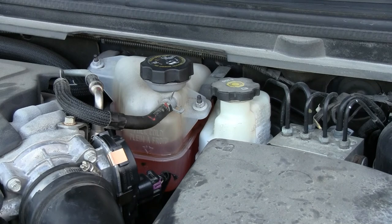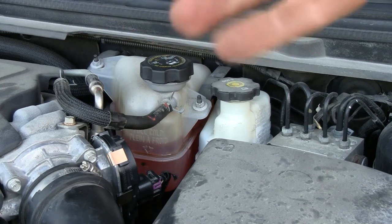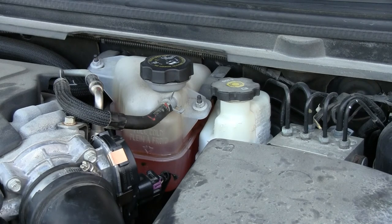I pressurized the tank and put the cap down tight, because it's a pressurized system — it actually runs cooler at pressure than when it's unpressurized. It goes up to 13 pounds; that screw top is rated for 13 pounds per square inch. Start figuring out what that would be in case of a boilover or a hose split — that's a lot of pressure, and you sure don't want to be messing with that. I hope this has been helpful to you. We have a lot of videos on here — some are fun derbies and races, and some are repair stuff. I really hope our repair stuff will come in handy so you can see you can do it yourself. As long as you're careful and take your time, you'll be fine. God bless, have a great day, stay safe.